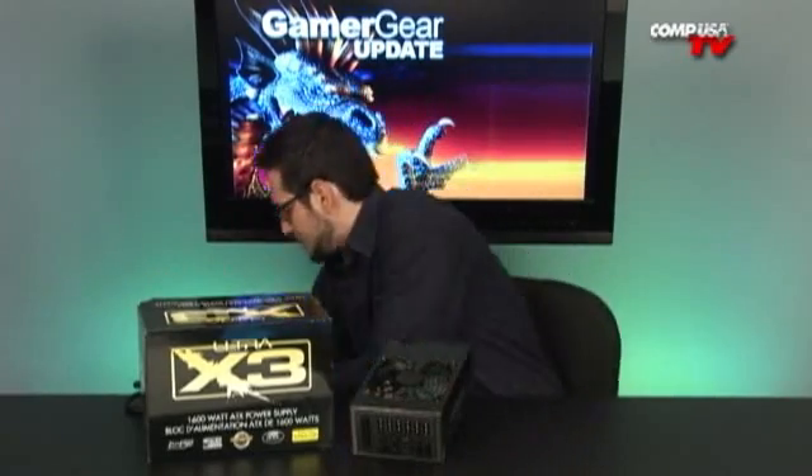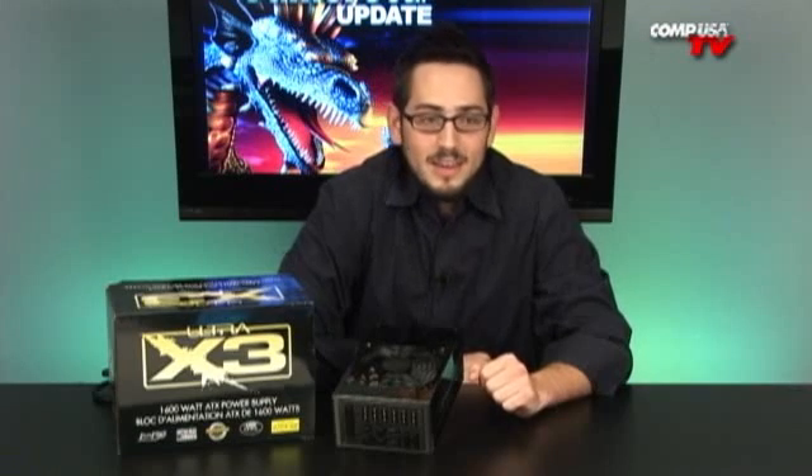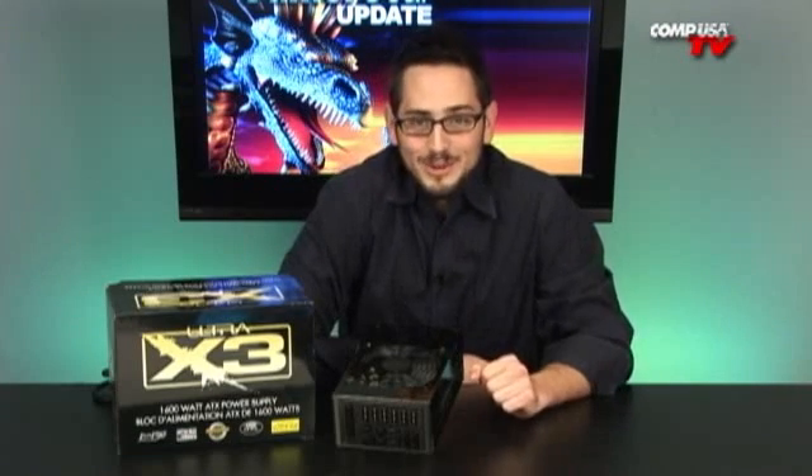Let's talk about something else too. Let's say you have three of these — I actually happen to have one right here. This is the GTX 280, the 'for the win' edition, so it's overclocked and more powerful. You know how many amps this thing pulls on the 12 volt rail? Just one of them? 26. So quick math — what's 26 times 3? Anybody? Buehler? 78. We have a talented crew here.